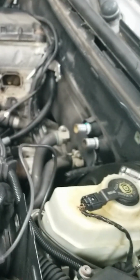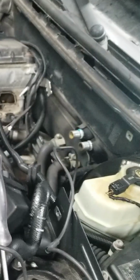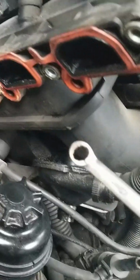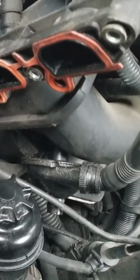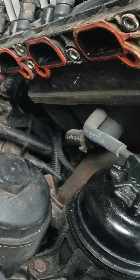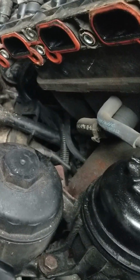All right, 2 days later, we're back to the drawing board. What I found was going on here is there's some corrosion in the cylinder, and that's why this baby was locking up. And taking the manifold off, see these gaskets here kind of messed up, and if you look on the block down here, you have little holes, and apparently some water was getting through because the gasket was messed up and getting in the cylinder.